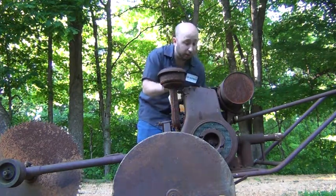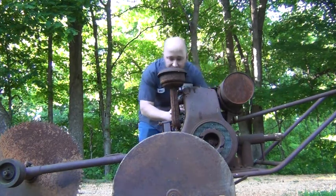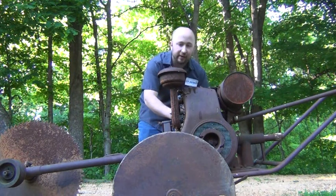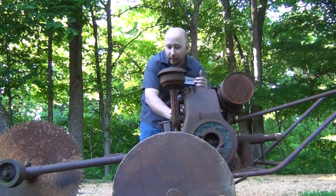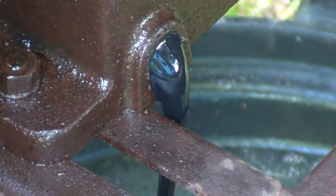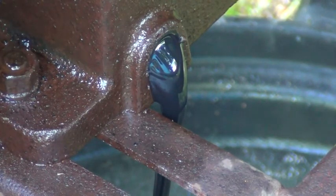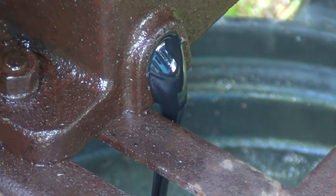When I get the spark plug out, I'm going to load the cylinder up on compression stroke and just generally try to get everything freed up and moving as good as I can. From there, we're going to change the oil and take a look at spark and things like that. We'll see what it's got in here for oil. It really doesn't look all that bad - it's old and been burnt. I was expecting it to be a little more chunky, but that's a good thing.